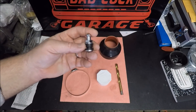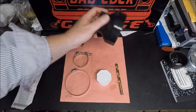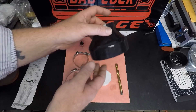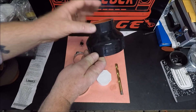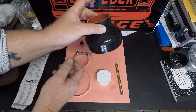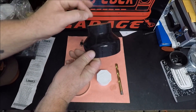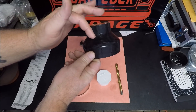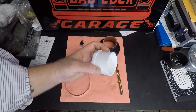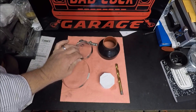We're also going to need a valve stem — that's going to be the screw-in type. You're going to need a coupler that fits your application. My turbo has a 4-inch inlet, so we're going to be using a coupler that goes from 2-1/4-inch to 4-inch. If you're having trouble finding a 2-1/4-inch to 4-inch coupler, you can use a 2-1/2-inch to 4-inch coupler, but you're going to increase the risk that it's going to slip off when you apply pressure. And of course, you're going to need the appropriate clamps.